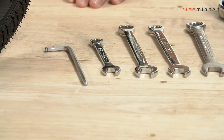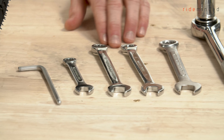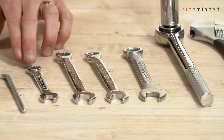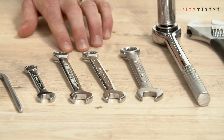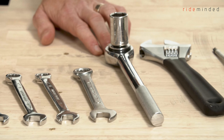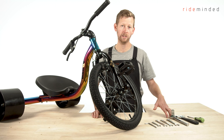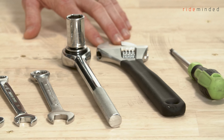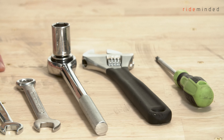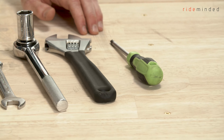To build our slider we're going to need a few tools. First, a 5mm Allen key. Then we need some spanners: a 10mm, two 13s, and a 15. You'll also need a 17 — I prefer to use a socket because of how you put the rear wheels on, it's a little bit easier. An adjustable spanner can come in handy if you don't have all the spanners or you're missing one of the sizes, and a Phillips head screwdriver.